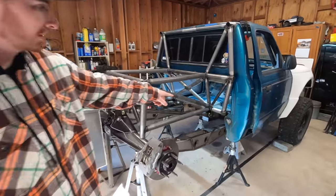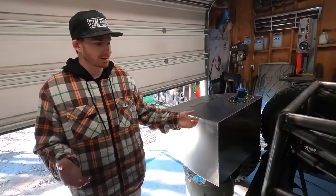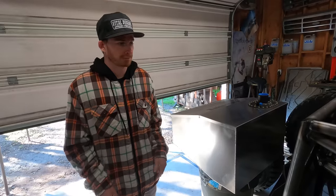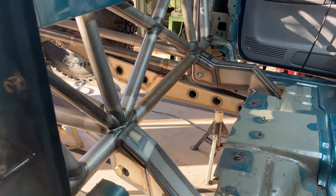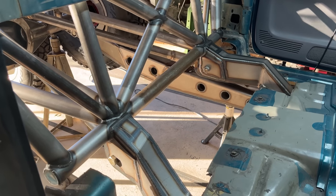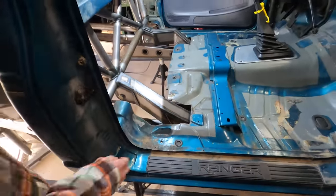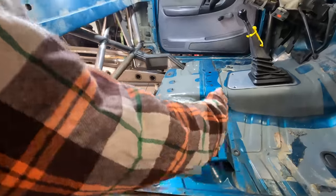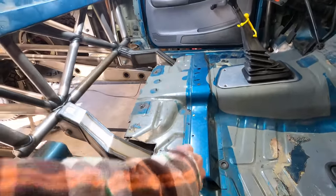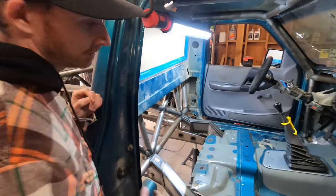After we filmed that video, the first thing I did was cut the frame off. We got the pivot boxes tacked into place just to get everything — all the lower links on the truck — and then I could start working up from there. But to get the pivot boxes into place, I had to cut the floor of the truck out. Just the section of the floor — I rough cut it with a plasma cutter. All this stuff will obviously get cut out more and paneled back in with nice tin work, then silicon bronzed back in so it's all sealed off.